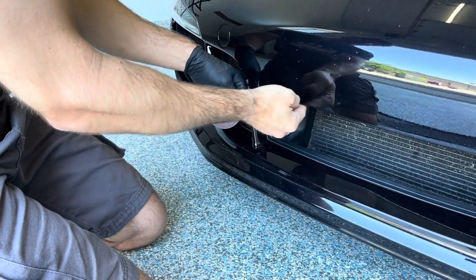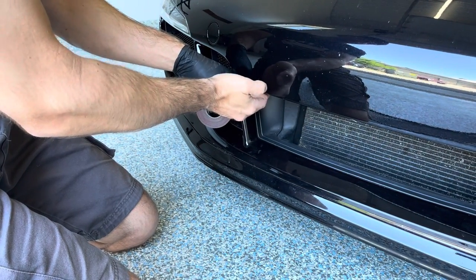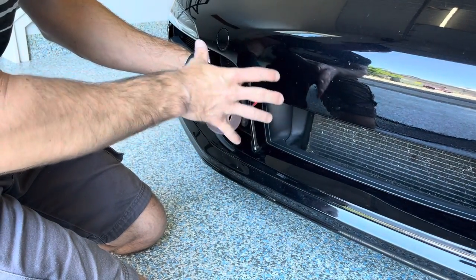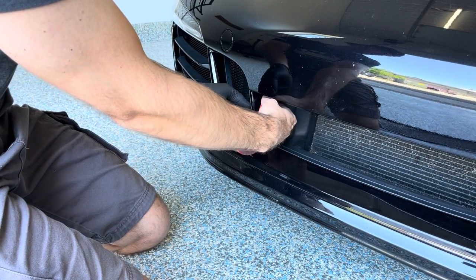When placing this pressure sensitive adhesive, it's nice to go over with some pressure. And the tape needs at least 65 degrees and warmer is much better for the adherence of this tape. Any colder, it won't adhere to anything.